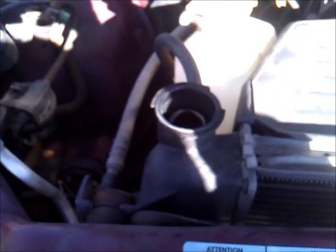We'll put these 3 screws back on, put that cover on, put the kick panels on. These kick panels just snap back in place. Then there's 4 screws, those go back on. I vacuumed it up to get all the dirt out of there. And that's basically the dash reinstalled with the heater core installed. What we have left is to hook up the battery, hook up these 2 hoses, and fill the radiator. That's it.